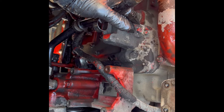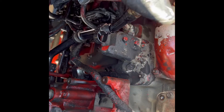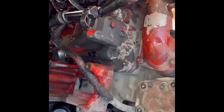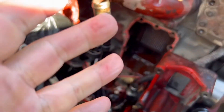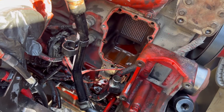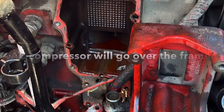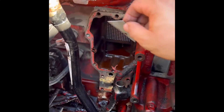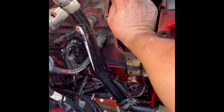After that we have to clean everything, get a new oil cooler, install new gaskets, oil cooler O-ring, put everything together and we should be good to go. Got the cooler off - be careful with the gasket, it's really sharp, cut my fingers. Wear gloves. Take it off and clean the gasket - clean the silicone from the gasket with a razor blade.